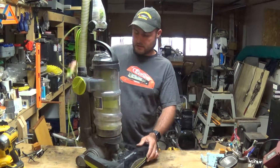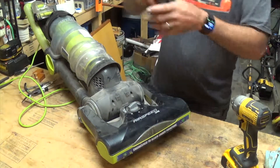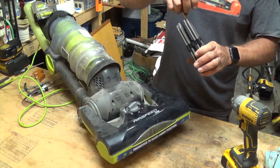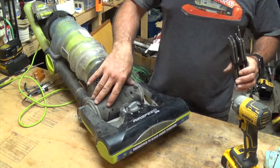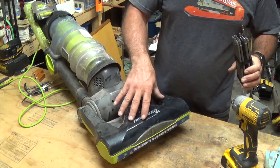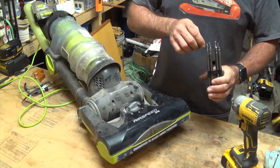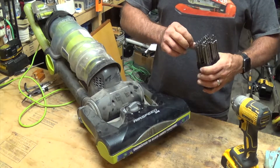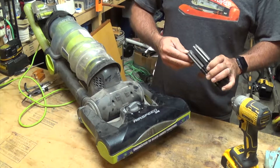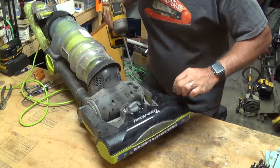Let's unplug it. As with most vacuum cleaners, everything is right here in this area. We've got a motor inside here, and this is what actually houses the brushes. It sounds like it's the motor, but we won't know for sure till we get in there and look. Most likely it's not even the motor — the motor seems to run fine; it's probably the bearings.